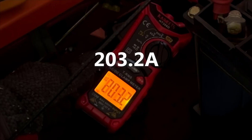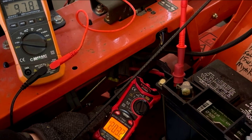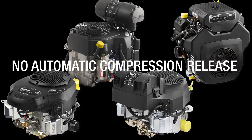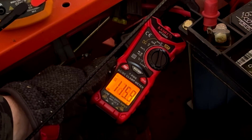On the third start attempt, amps momentarily peak at 203, with battery voltage dipping to just below 10 volts. If the battery was weak or low on amperage, I suspect this is where it would cause problems, with starter stall being the likely result. Twin-cylinder Kohler engines with electric start only have no automatic compression release mechanism, meaning increased load on the starter — especially when rolling through the initial compression stroke during a cold start. Any weakness from the battery, or increased resistance from cable or connection problems, will increase the likelihood of starter stall.